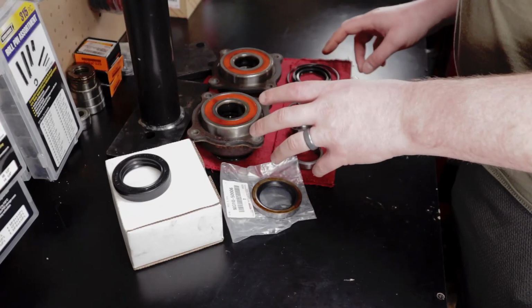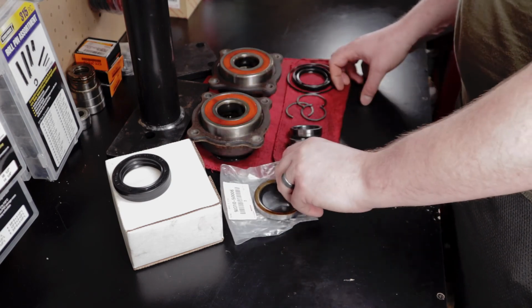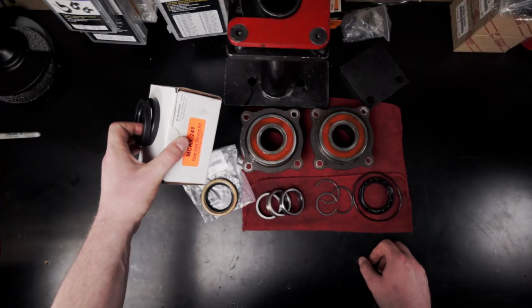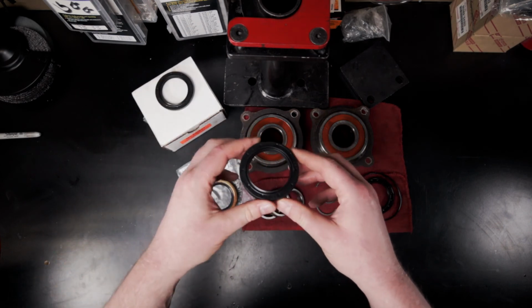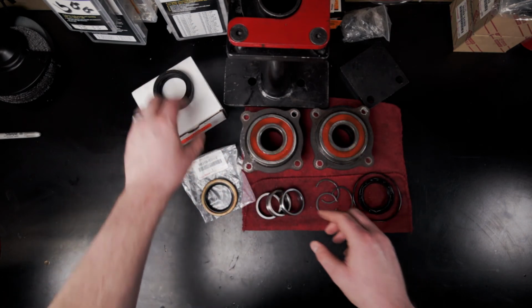First, I think for the 3rd gen 4Runner, it's critical, as I discovered, that you source an OEM Toyota axle seal. This Marlin Crawler Kit is a really nice, complete kit for the price point, but the seals in it should be replaced with OEM ones. The seal they include just isn't as pliable, and I believe seals in a way that the engineers at Toyota didn't design the axle housing for.